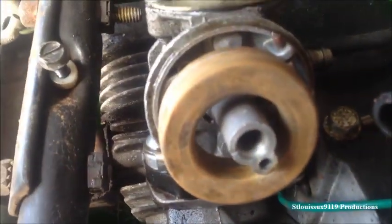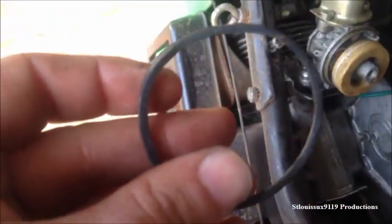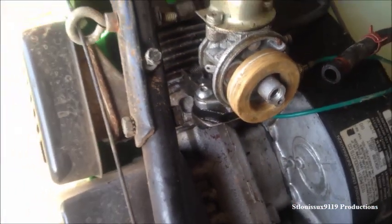Also spray through this little fuel inlet right here. Just spray it in any real holes you see in there. You can see I removed this O-ring — it's a little deformed. In order to make sure the primer works properly and that the carburetor seals properly, you have to make sure this goes back on in the right fit, form, or function. It just goes around this outer lip all the way around. When you put the carburetor together, make sure this is good, otherwise your primer more than likely will not work.